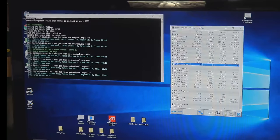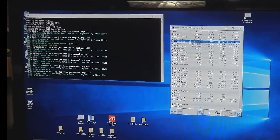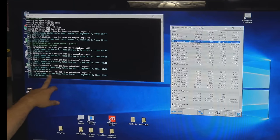So as you guys can see, this thing's rock solid. And right here, you can see it's running about 109. So, you can get the 570s down to 70, 80 watts. These ones you can usually get down to 90 to 100. If you want to run at this kind of speed, you're going to use a little more wattage. You're going to get them down to 100, but that's better than the 150 that they normally run at. 145, 150 watts. So we're knocking off almost 50 watts by downclocking the GPU and power stage on it to 1100.